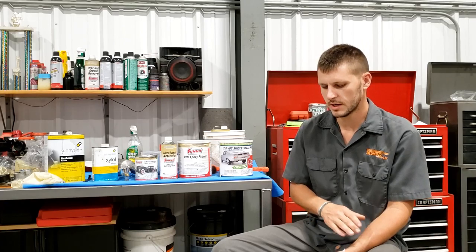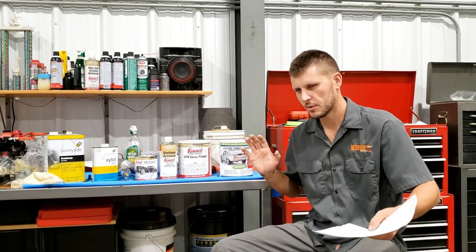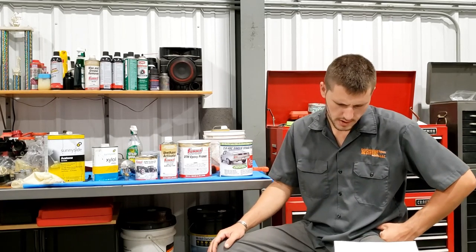And Line-X is usually applied an eighth of an inch thick, but as fast as that material comes out of that application gun, you can get a quarter inch of material on there pretty easy. But my point is, anywhere I'd be bolting a bracket back on, like let's say I'm bolting a spring hanger back on, I have an eighth inch of material now between the frame and the bracket, I just move my leaf spring out. So my leaf spring mounts on my axle aren't gonna line up right with my leaf springs. And that's why I put all my scab plates on the inside of the frame rail, because I didn't wanna interfere with my leaf spring mounts bolting back onto the frame. So that's a pretty big negative aspect, is the thickness that it adds.